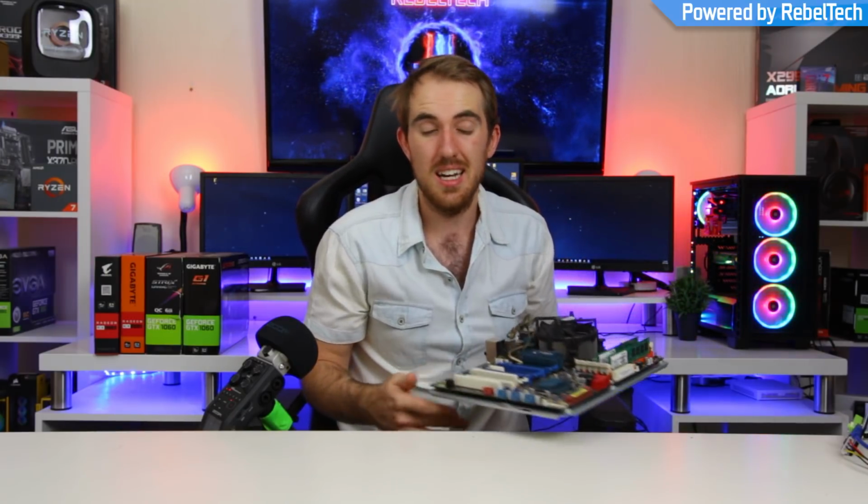If you are looking to get an entirely new motherboard and a new CPU and everything, I would recommend that you go for a Celeron CPU, just because they're cheap and they don't use a lot of power. And then a motherboard, you can go for something like a Z370 or a Z270, because usually they do have up to 6 slots, so you can actually add 6 GPUs, but you don't have to go that high. You can use your old motherboards. I've even used Core 2 Duo systems, so 775 sockets, so that's really old. You can even use that and that will be fine, because the most important part of the entire mining system is going to be your GPUs.